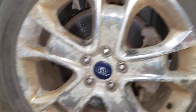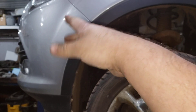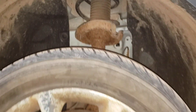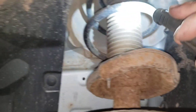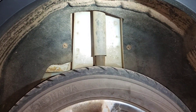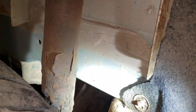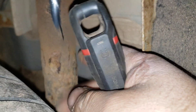We've got another corroded wheel on the other side. We went side to side and everything feels nice and tight. We already looked under the hood — the belt is getting a little aged, just like the tires. Looking at the springs, I didn't hear any popping or banging when turning, so no stuck spring mounts. But the rear shocks are getting swelled up, which is a good sign they're leaking oil — it won't be long before those blow out.